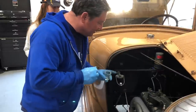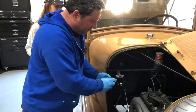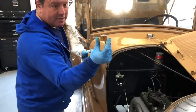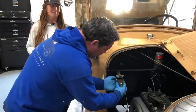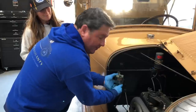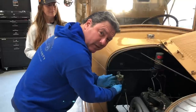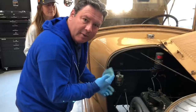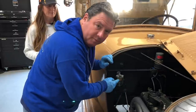It's time to reassemble the fuel filter assembly. I do a little something different on these. This is normally what is used as the fuel filter on a Ford Model A — it fits down in the bowl with rubber over the top, but the problem is these are very porous, so I cheat. I use a Wix 33039 filter that looks like this — it's a modern fuel filter and it fits right inside the glass bowl on a Ford Model A. You put the rubber ring on top of that, make sure you can see the holes all around it, get it centered. Now I know there are people in the comments saying you can't see the dirt in the bowl with this filter, but you know what — the dirt is going to be inside that filter and at some point it will plug. Then I can just pull it out, put it back together, and be on my way. Nothing that would plug a jet in a carburetor will make it through that filter, so that will keep you on the road.